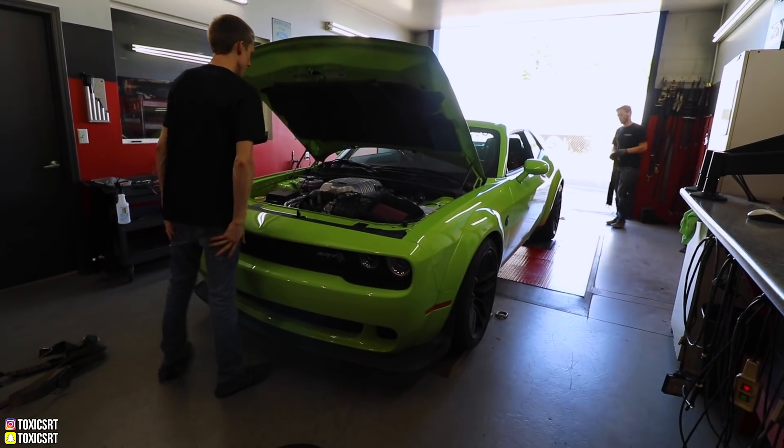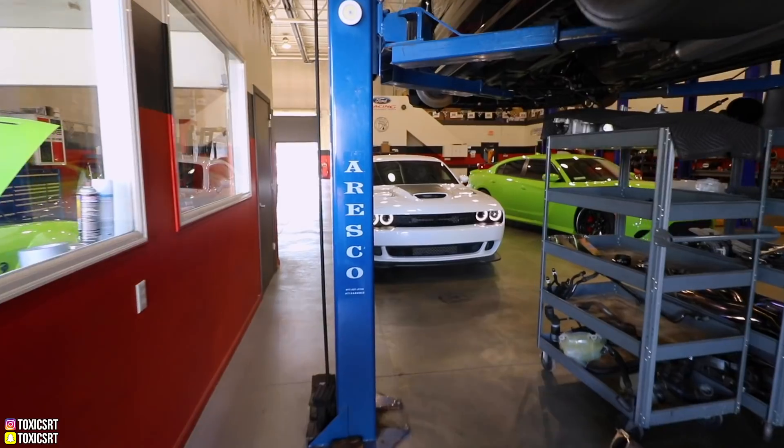We got the car in here now and it's going to get strapped down. My car has a 2.62 gearing, not the 3.09. I didn't want the 3.09 just because it isn't so good when the car is making 850 wheel and up, and that's kind of my goal — to be way over that. It works really well if your car is making about 850 wheel or below, so it's not going to put down as much power right now while it's fully stock as it would have with the 3.09 gear. My last Hellcat didn't have a 3.09 gear and it ran super amazing.